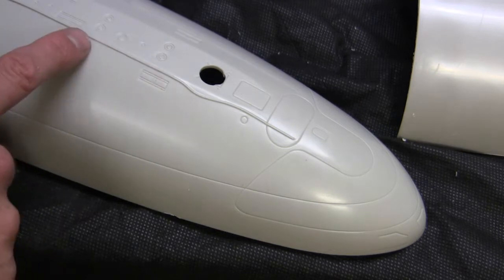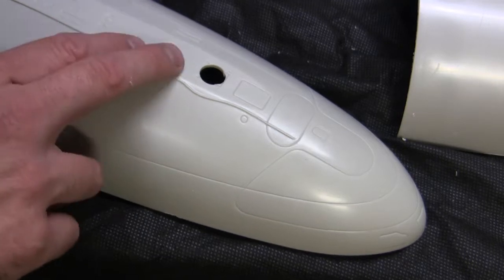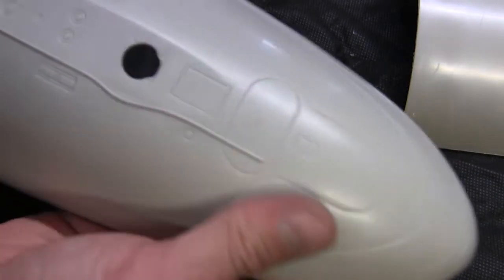and it'll prevent any sort of snafus like over-drilling. If you do over-drill, you are going to have to replenish that cutaway area with a little bit of bodywork. It's not the end of the world, but it is going to add a little bit more complexity to the procedure. So with the Dremel, or I should say the round section, out of the way, the next step is to tackle the squared off sections on the top.